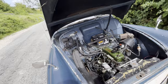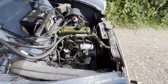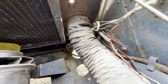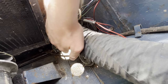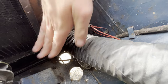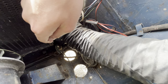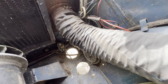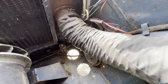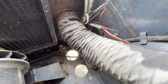That means something between the power source and the rear lights isn't working. I'm going to bet it's the brake light switch, which is buried down here. There it is — just these two wires. What this switch does is sit in the brake lines: when you put your foot on the brake pedal, the brake pressure in the line pushes a little ball bearing up inside with a diaphragm, and that closes the switch and puts the lights on. It's like an oil pressure switch that works the other way around.